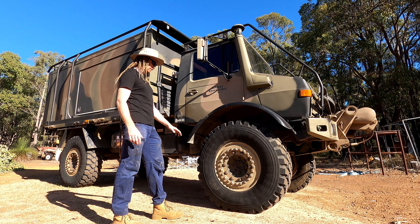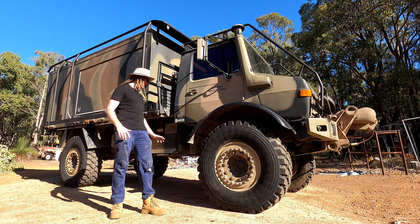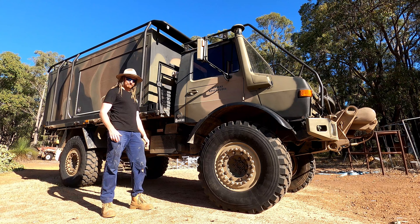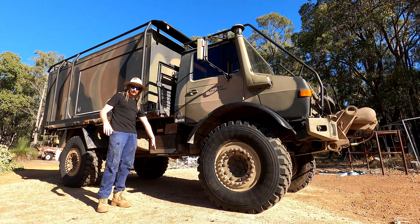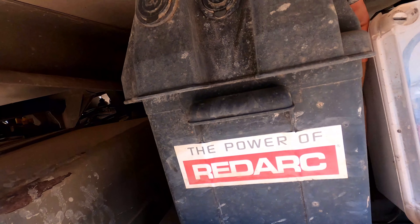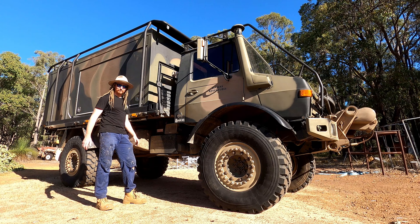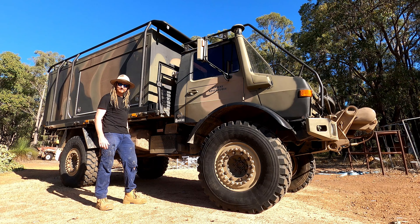When I had the first setup, I had a secondary battery which I wanted mounted underneath the tray. I needed to mount the box a little bit lower just to fit the secondary one in. After I did that, I had the Redarc charger charging it from 24 to 12 volts. So I had a 12 volt deep cycle on board, and I could just plug my fridge in — plug whatever I wanted to, really.